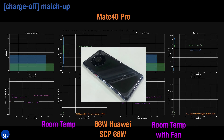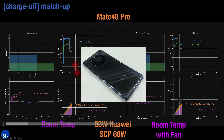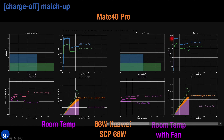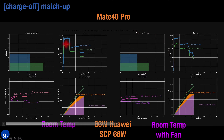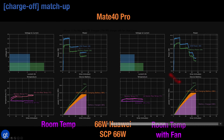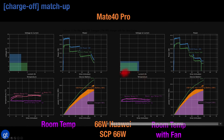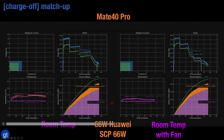Next let's look at the temperature sensitivity for charging using the 66 watt charger with the Mate 40 Pro. On the right we keep the same setup with a fan to remove excess heat, and on the left we remove the fan to see how well the phone charges at a higher temperature. You can see that with a fan, the USB power and battery power is higher initially for the first 20 minutes, but generally speaking over a longer period of time there is pretty similar charging performance and charging times for both cases. Even with a fan in the setup to reduce temperature, it doesn't have that much impact on the overall charging rate.